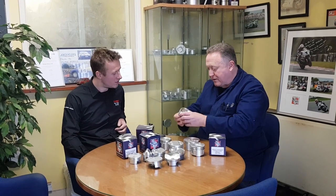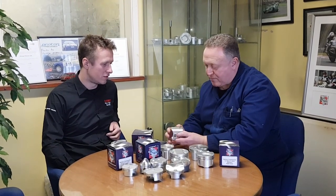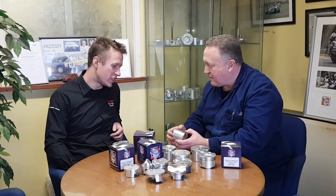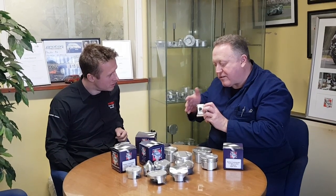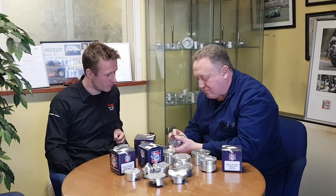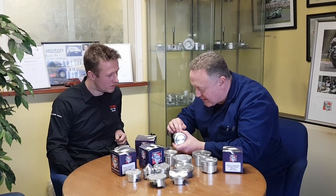You've also got the vertical shape because right in the combustion chamber is where most heat is, so that will be the smallest part of the piston. The largest part of the piston is probably about mid-skirt, and it gets smaller in every direction from there. So when you measure your piston-to-bore clearance, it's not right at the bottom — it's about there. It varies on different pistons, but we never put it right at the bottom. We like to work in conjunction with the customer; if they can send used pistons back, we can see if there are areas where we could reduce or increase clearance.